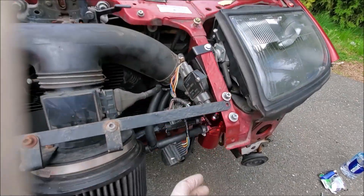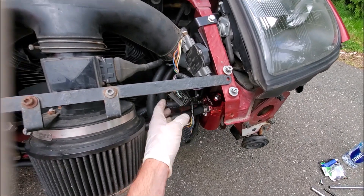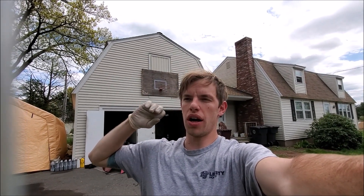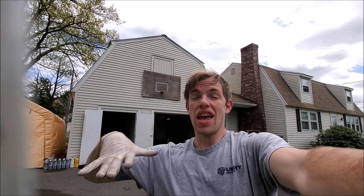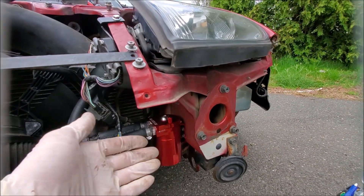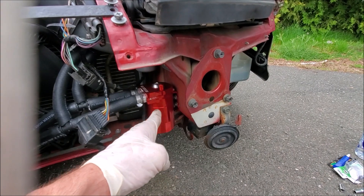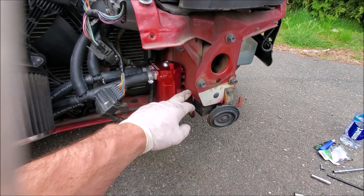Right now I'm just going to clean some stuff up — I relocated the PTU but I need to fix my wiring a little bit. I want to give you guys another look at the PCV delete. My first video was done at the track, the second was the full cheap-and-easy PCV delete, and this is the proper way with everything deleted and plugged up. On the oil catch can, I do have an air filter you could put on top, but there are arguments about keeping the system pressurized, so I'm just running it as-is — it is a baffled catch can, so make sure you get a baffled catch can.